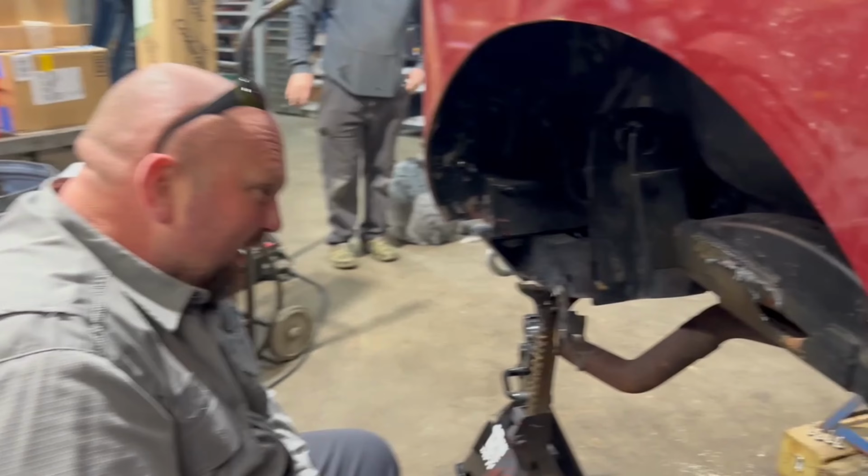Broke the axle shaft in the back of Squatchy and twisted another one, and we had already twisted one last year. So the 10 bolt, I've exceeded the limits of it. It was good for 4 years, other than that one twisted shaft last year. But after breaking this one, especially being in three pieces, which I think was already twisted, we decided it was finally time to go ahead and put the one tons that we've had stuck back under it. So that's what the start of this is.